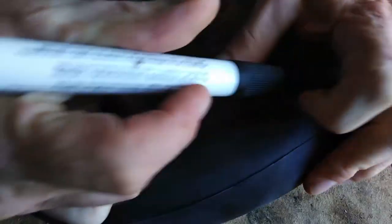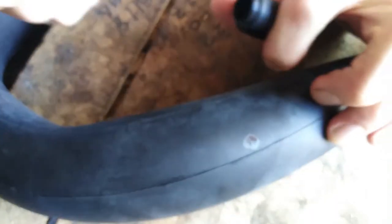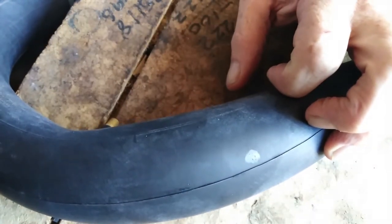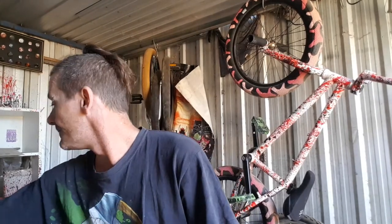Once you've located your hole, place it down remembering where your hole is and put a mark on it. Simple as that. Now some patch kits will come with chalk which will make it better. As long as you remember and you can see the mark, you're all good. Now grab something like a small allen key and deflate your tire, preferably something that's going to fit on the valve and not break it.